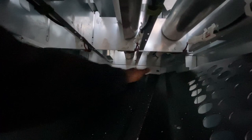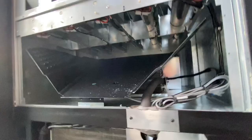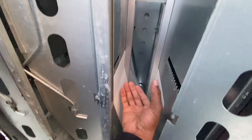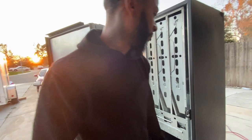When you come check the soda machine, put your hand right here and feel the air blowing — you'll feel that it's cold. The reason you want them to have it running ahead of time is it takes about 10 to 15 minutes for a soda vending machine to get cold. If you told them to put sodas in ahead of time, you can just grab a drink and confirm it's cold. Otherwise you risk buying a machine with a bad compressor.